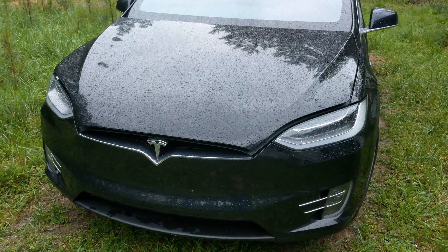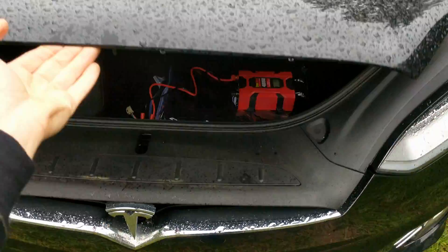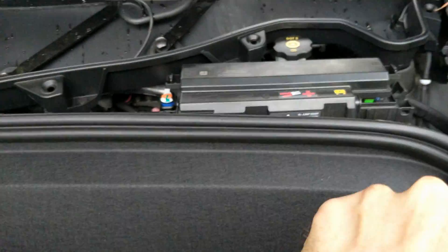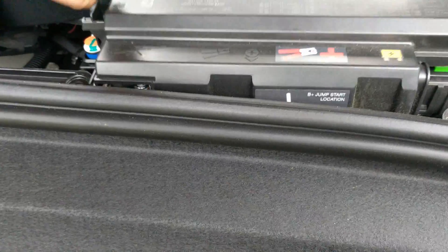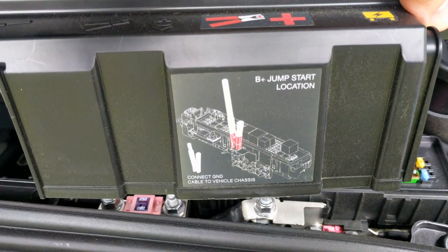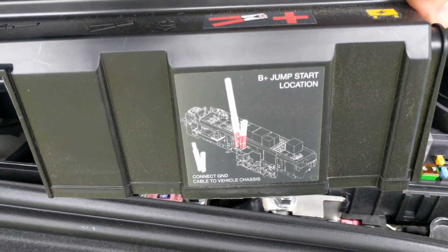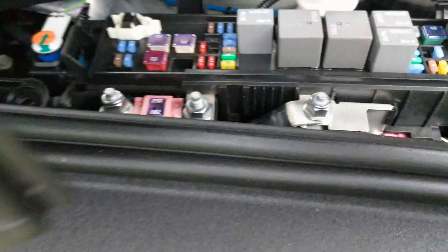But it does have a way to do that, and that is you've got to tap into the 12-volt power system directly without those small fuses. Here's how you do it. You take this cover off right inside the frunk after you open it up. Then you take off this 12-volt fuses relay cover, which you've got right here. It lists a jumpstart location — that's where you want to connect. You want to connect a high-powered inverter or transformer to this with the red lead right here. Your black lead would go anywhere on the chassis, which is in here.